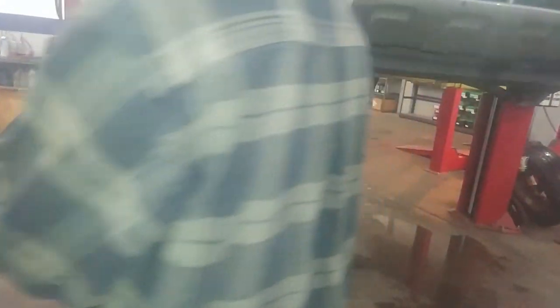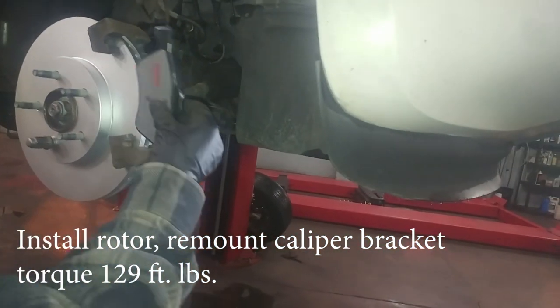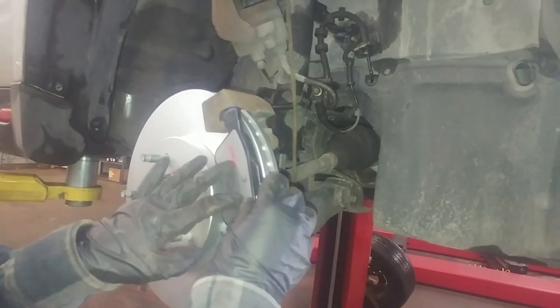One pad on this side, just going to drop in the inside — actually outside, I misspoke. Look at that, it's installed. We have to push the fingers into the hole of the caliper, so you're going to have to manhandle it in there. Let's see if you can get all three fingers in. It'll probably just collapse when you push it in there. Boom, nice — that's perfect. Then you can unmount the caliper from the bungee cord.